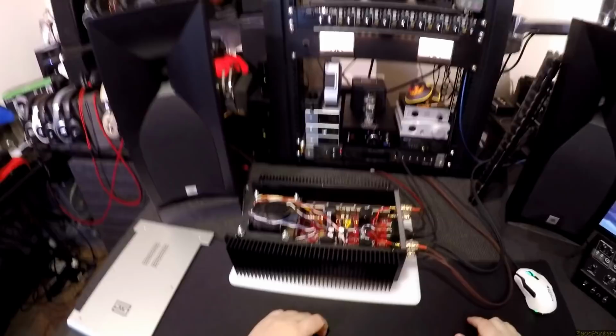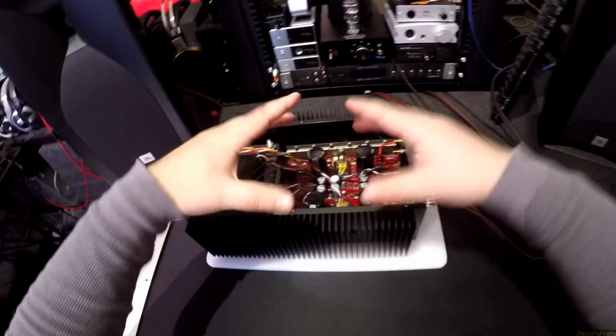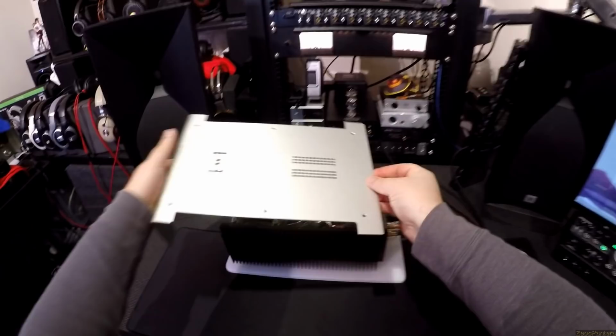These are 6 ohm, by the way. So if 8 ohm is 100 watts and 4 ohm is 200 watts, we could go by math and assume this is 150 watts a channel. Really a real 150 watts a channel, with lots of power stored up and heat dissipating behind it. I don't want to spit in it. It's the only thing I'm concerned about. I have no other concerns on this earth, but electrocution. What's that? I just don't want to spit in it.